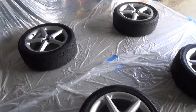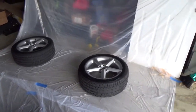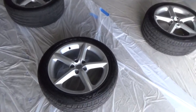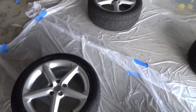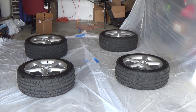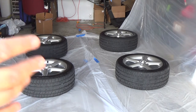All the wheels are clean and ready to be painted. I have them sitting here in my state-of-the-art spray booth that I created in my garage. Let's go ahead and get these wheels painted black. The first coat is supposed to be a really light coat just to get the Plasti Dip to grip onto the wheels themselves, and once that first coat is done we can start adding heavier coats after that.